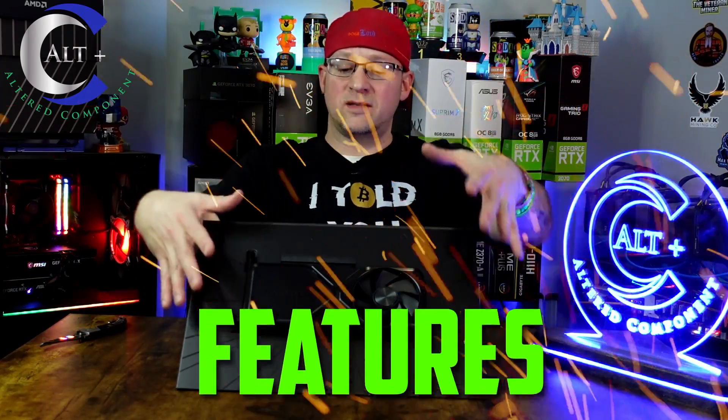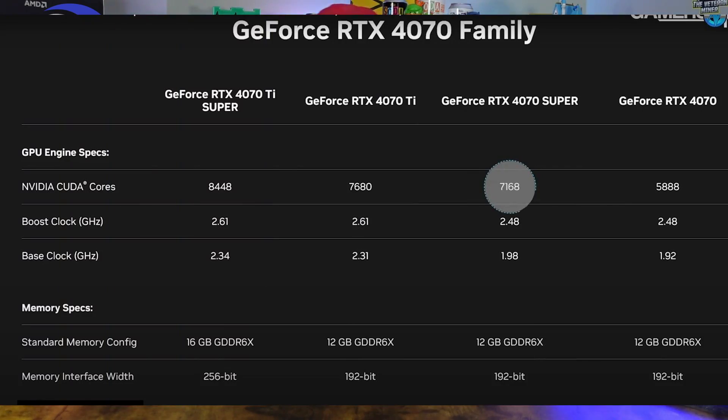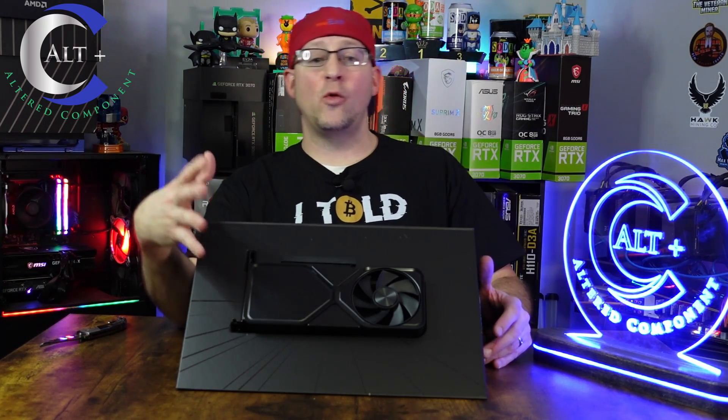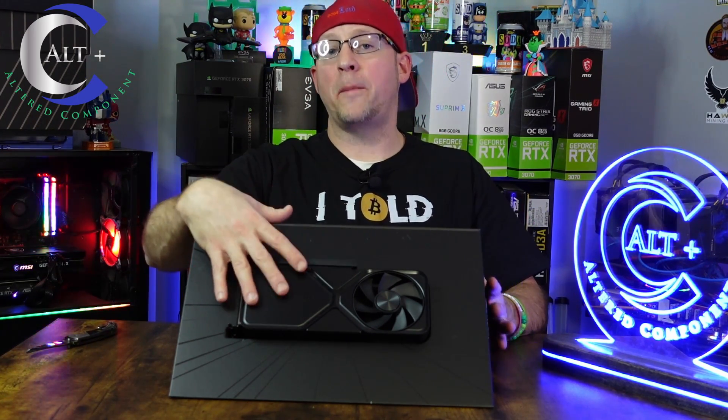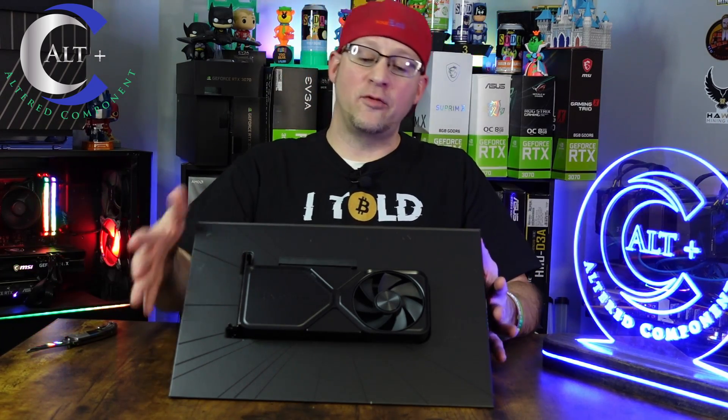Let's talk about what makes this such a good GPU. There's a big improvement over the RTX 4070 — it's not just better memory like sometimes in the past. This actually has way bigger core count: 7168 cores, whereas the regular RTX 4070 only had 5888 cores. That is 18% more cores, plus more RT cores, more TMUs, and more ROPs to go with it. It's using only 20 watts more power than the standard 4070 — same TDP bump but way more performance — meaning you're actually getting better overall efficiency. That's another great win.